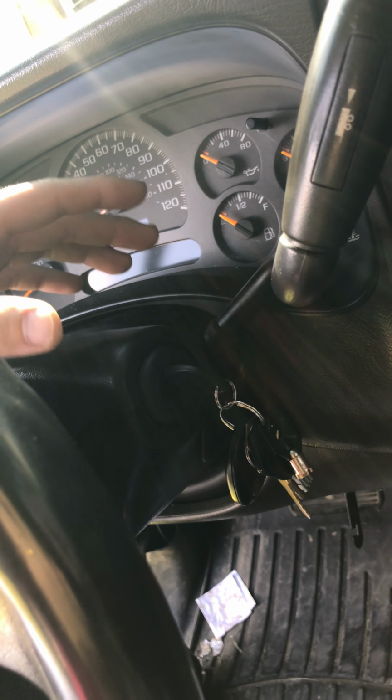And then if you do end up swapping to 5-speed, and it's a 4-wheel drive, and you're going to do the dogleg transfer case, basically you've got to find a base model, either a 2-wheel drive truck or one that has the dogleg transfer case from the factory, and you can get this little cubby hole to replace this so it looks all factory.